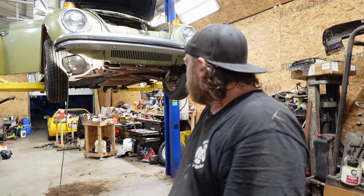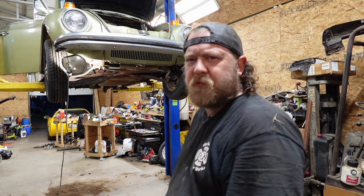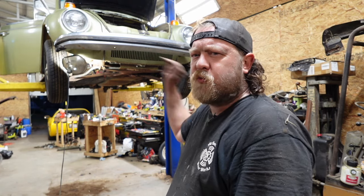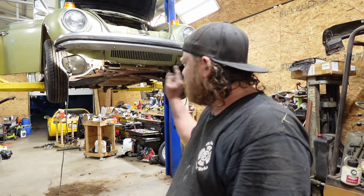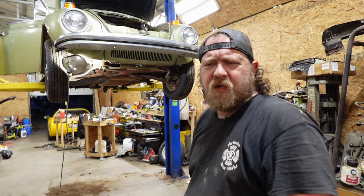Like I said, I think I could jump the pump possibly from the junction block in the car, but I'm not sure if that actually feeds backwards from the doubler relay or if it goes to the doubler relay from the pump. Anyway, I know where there's a fuel pump wire. If it's gonna work or not, I guess is what I'm getting at. So give me a second to diagnose and then I'll be back.